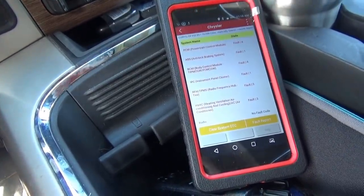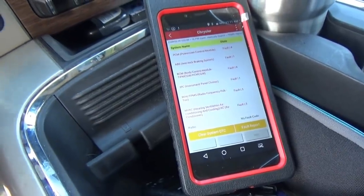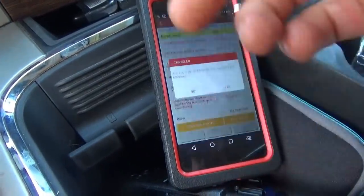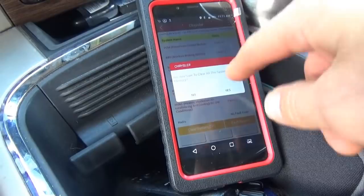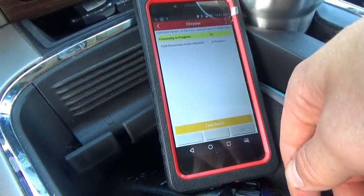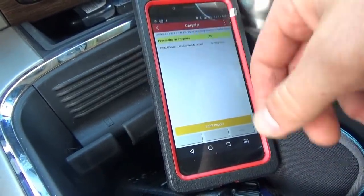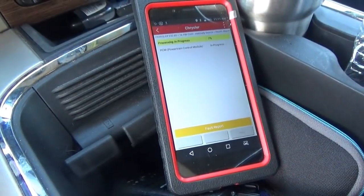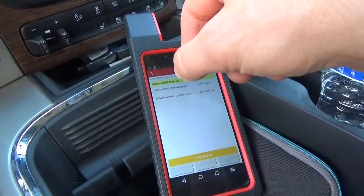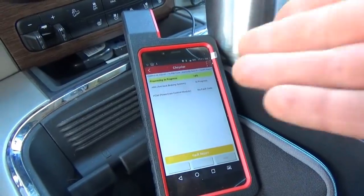Just do a fresh start here. Okay, accessory. And then we'll run the truck, look at the data, and unplug the control wires at the alternator and see what codes it sets, just to get an idea of what the voltages are. Then with a test light maybe, we can short that wire to voltage or to ground and see what the computer says when these faults occur.